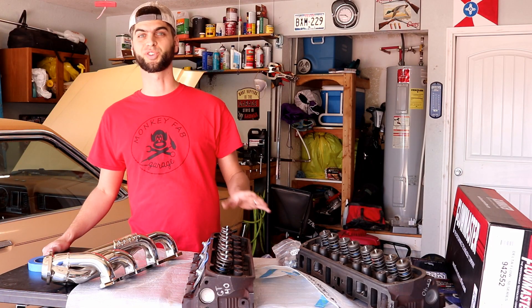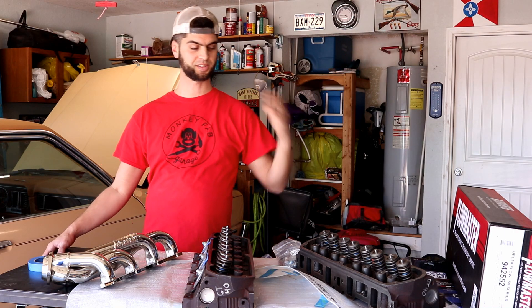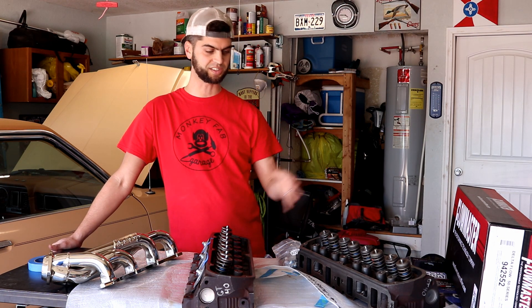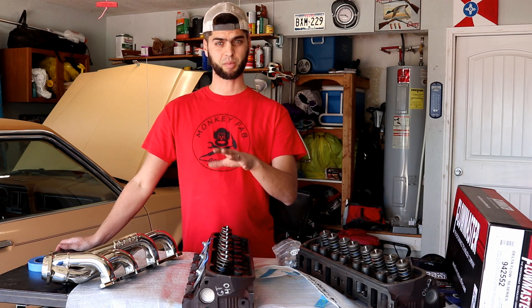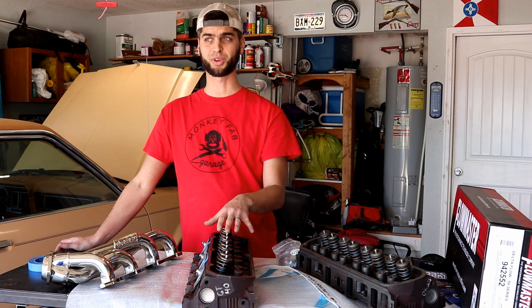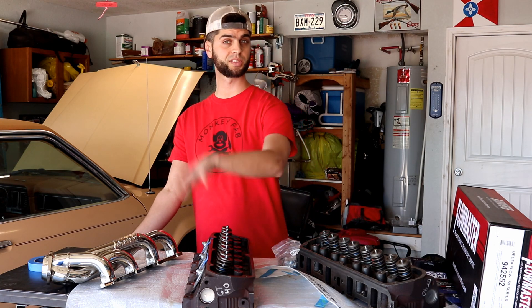I'm pulling a page out of Rick's Garage playbook on his steps, so I'll leave an info card to his video on the same exact stuff — we're not going to get into detail here, just let his video speak. One other thing about why I'm doing a head swap as opposed to anything else: bang for your buck. When you scale down from nitrous, a blower, or a turbocharger, I feel like camshaft and heads are one and two. And this whole project car is meant to be a learning experience — I thought I'd learn more by doing this than a simple intake manifold and four-barrel carb swap.